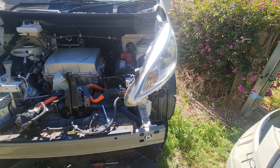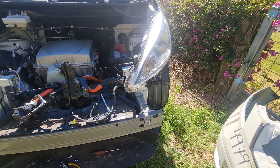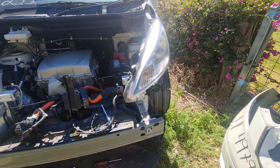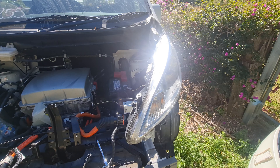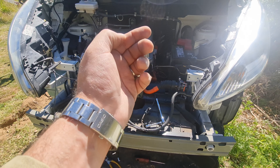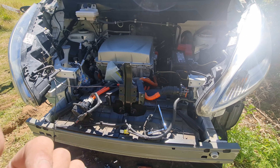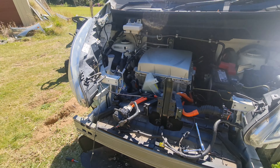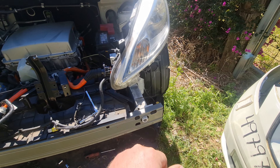Now that's a pain. For me it doesn't matter, because I'm not replacing the headlights — I'm pulling them out and someone can buy them. I don't care about that. What I care about is getting this whole front crossmember out so I can just pull the motor clean out the front. That's the next plan. But yeah, to remove the headlights you've got to pull the bumper off.